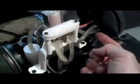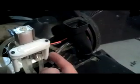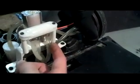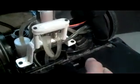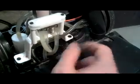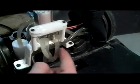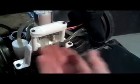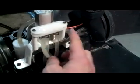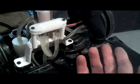But now you'll see I've got these hoses here onto the suction thing that goes onto the water reservoir. Those two hoses are on there, and then I've got my 4 hoses here, which I had disconnected. I believe hose 2 and 4. Yeah, 2 and 4 had come off, so I could lift the bottom up. So again, word to the wise: number these. I went 1, 2, 3, and 4. But I put a horizontal line on these hoses too, so I could differentiate them from these, just in case they were all the same length. So now we're a step closer.